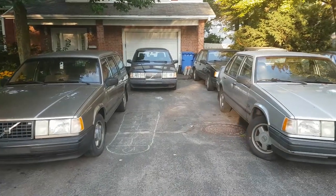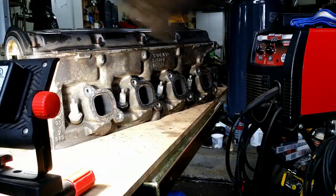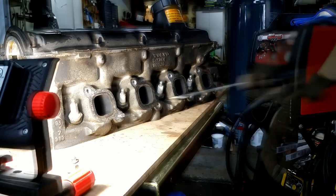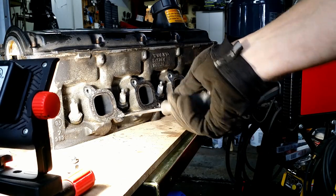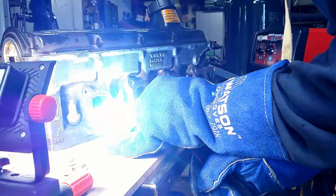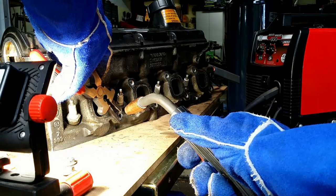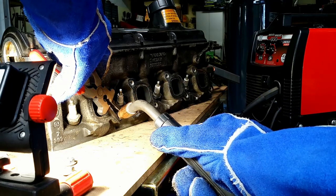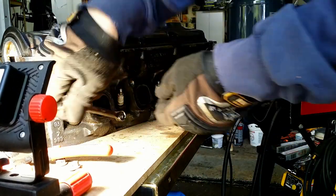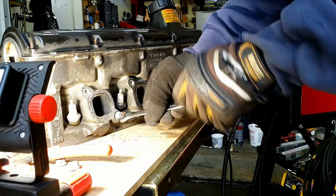It pays off to have a fleet of the same cars and a few extra parts in my garage. So I pulled this junk head out of my stash, and will practice the welding nut technique. A piece of stud goes into the head. I build up some metal on top of the stud, and then weld the nut. The stud and the nut became one. The stud gets all the weld. The aluminum head acts as a heat sink and it doesn't melt.